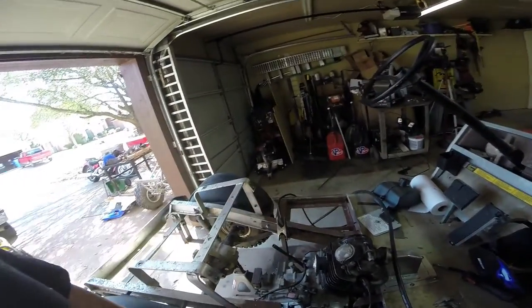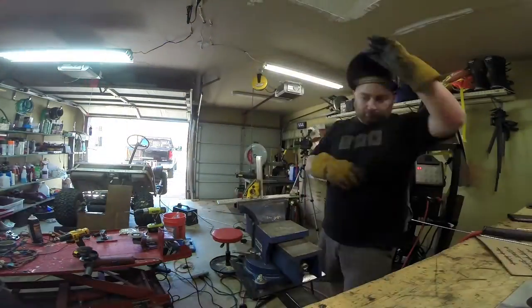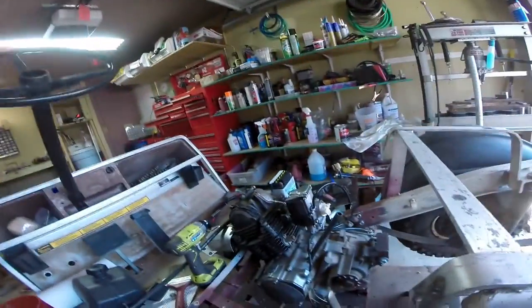While we're waiting for the aluminum gas tank mounts to cool off, good news: our brand new carburetor is in. I took it apart and checked the jets — they're definitely different than the jets in the factory one. We're basically going to have to tune it later once it's running, figure out richer versus leaner and order some jets, because we're running a different exhaust now. Brand new carburetor bolted right in, and compared to the OEM one it looks just as well made. For 60 bucks, not too bad.